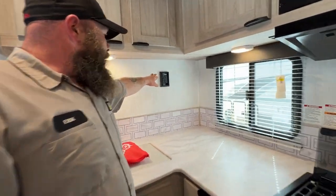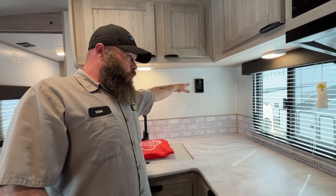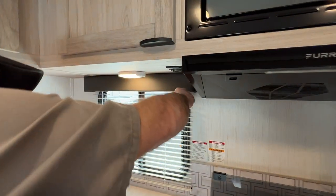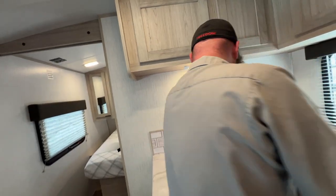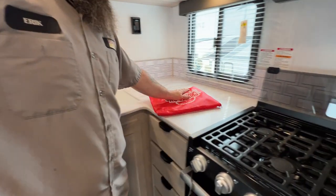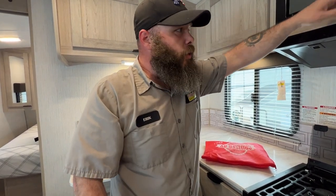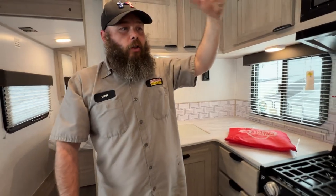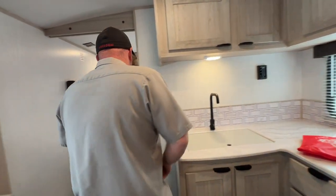You've got your GFCI outlet here — generally if you find that some outlets in the coach are not working, come check that this hasn't been tripped. There's also an outlet up here along with another light, which you can turn on and off by hand. This compartment here contains most of the manuals for the coach. If there isn't a manual in the coach, most have gone paperless and are online — look up your product name like Greystone, Furrion, or Norcold to find that information.